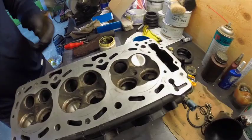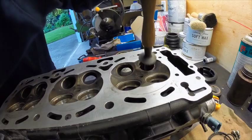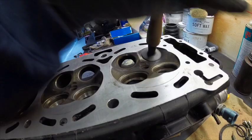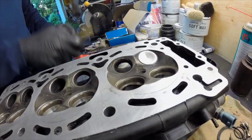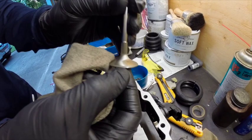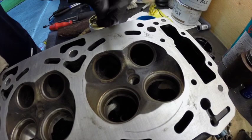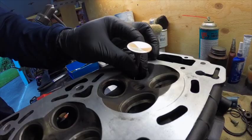Using a fancy valve tool, which is just a suction cup. When we wipe that down, you've got a matte ring all the way around the outside of the valve, and then we got the same thing on the seat. The lapping took the gloss off and mates the surfaces together. Once you've lapped the valve into a location, it should stay in that location. So we'll use a little bit of brake cleaner here.